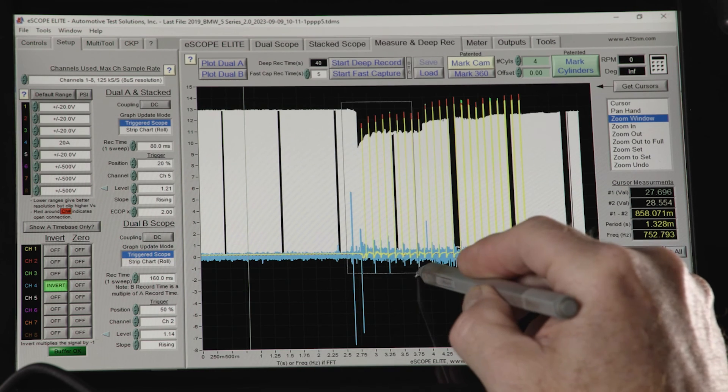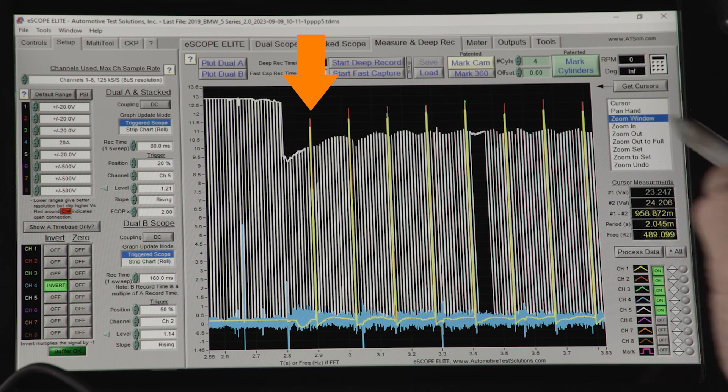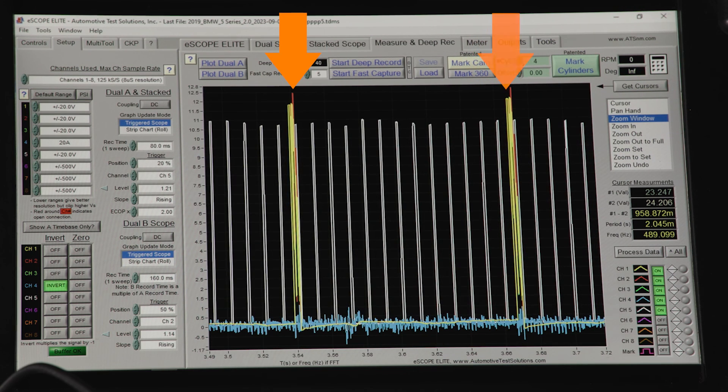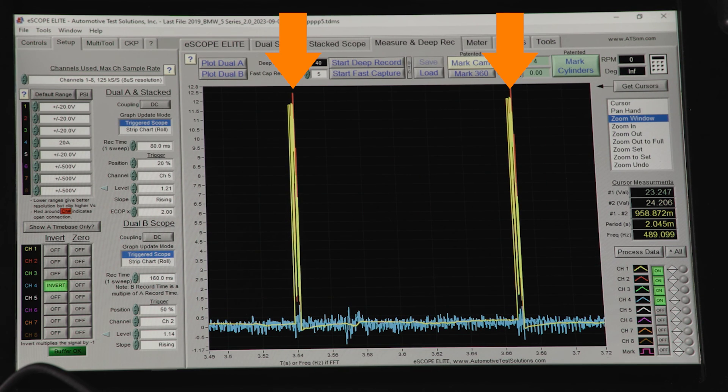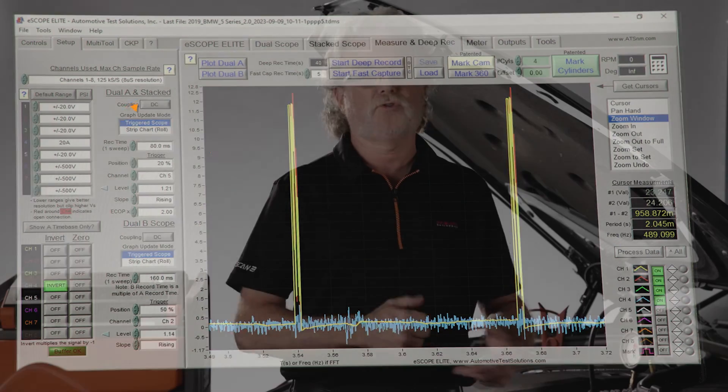The signal currently displayed is from a vehicle with an internal short inside the fuel pump itself. The FPC tries to activate the pump — it doesn't activate, so we see all phase pulses occur at the same time. The FPC is checking the circuit; we can assume it is looking for current feedback to begin switching the pump phases. But without the right feedback, it can't start — this is due to a short in the circuit. If the short is intermittent, a fault code may not be set. With these waveforms, known good and faulty, you can confidently test the in-tank fuel pump electrical circuit and determine if it is causing the symptom you are trying to diagnose.